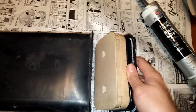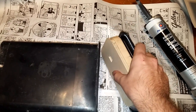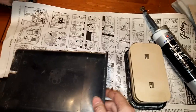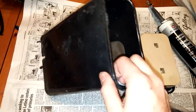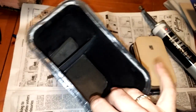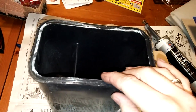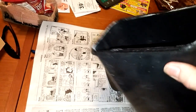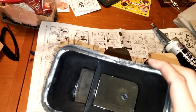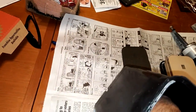And then you'll be left with something similar probably — it's like under spring tension — and it'll be filled with a bunch of activated carbon or charcoal. This will be on top; take that out, your filter. Yours might be different. It'll be filled with a bunch of carbon in here, just go ahead and empty it out, and then you'll see some filters at the bottom. You'll need to replace these filters.